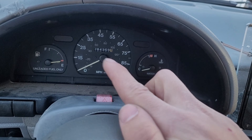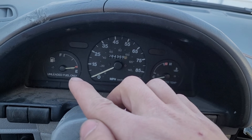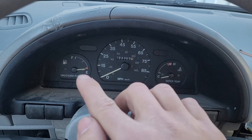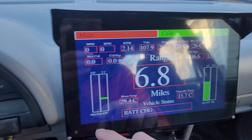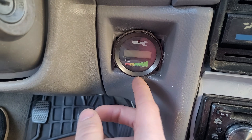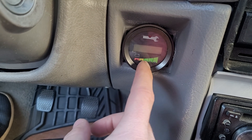The speedometer still works and the digital speedometer here works also. The gas gauge is actually hooked up to the kilowatt hour reading, so it tracks with your battery percentage. The water temp gauge is hooked up to the motor temperature since the motor gets the hottest — if it starts going red you'd want to pull over because your motor is too hot. Down here is an additional gauge that hooks up to the Curtis controller and shows redundant info like amps and RPM.